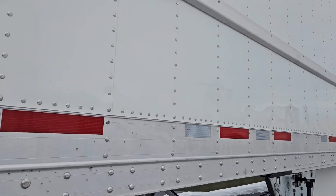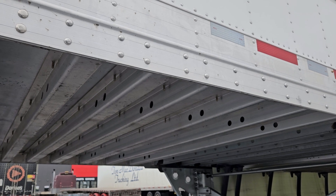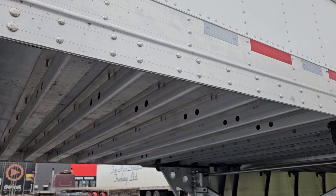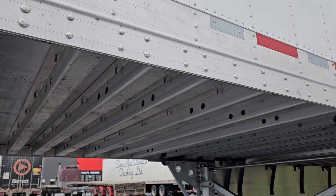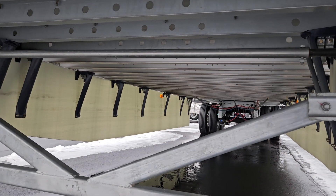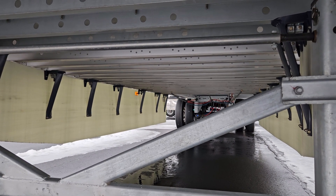Let's have a look under the trailer. Behind the coupler plate, you're gonna notice these cross members right here, these are tub style cross members and they're aluminum. They're not a steel cross member, they're not an I-beam cross member like a lot of the other guys are using. Lighter, and if you have a tire that happens to go up and hit one, whether it be a blowout or into a yard that's a bit of a hill or a hole, it's not going to snag the cross member and break it. Fully galvanized landing gear, really nice. All of the cross members down through the belly, down through the bay area, they're 12 inch centers and they're aluminum. They're not steel, they're not going to rust.